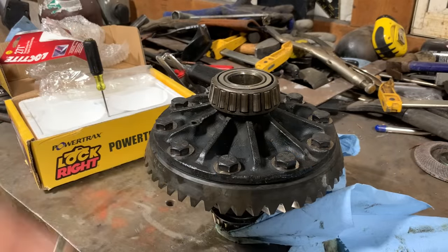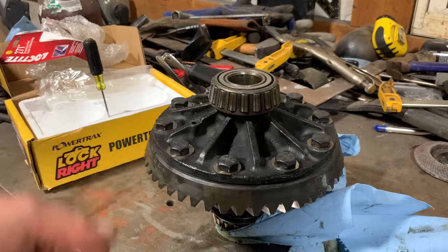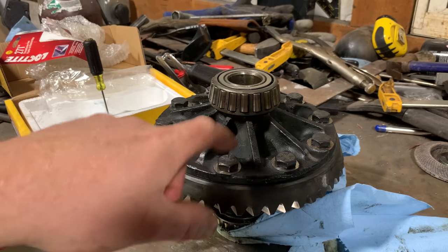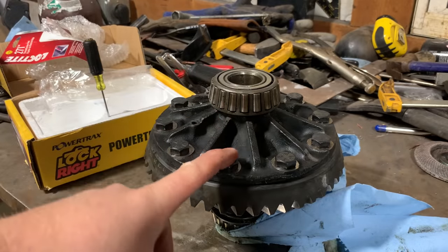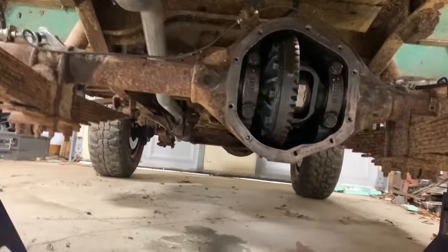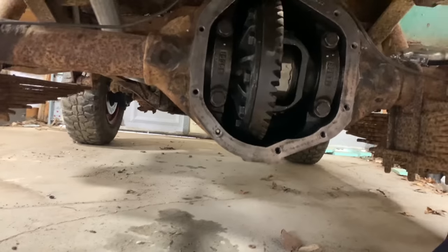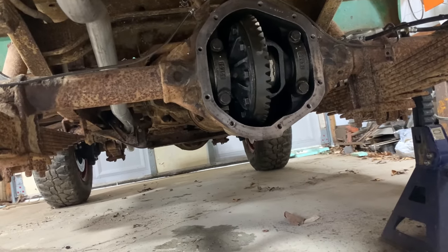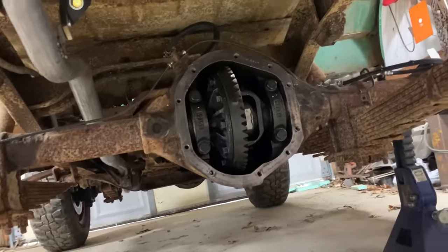I've got my ring gear back on. To recap: degrease everything, get as much oil off as you can, degrease the hardware. Red Loctite and locking tabs if you need them — you can buy reproduction ones too. I do Loctite and the locking tab because those tabs aren't that hard to bend. All these get torqued down in a star pattern, 38 to 42 foot-pounds. I went ahead and threw that carrier back in — it goes back in the same way it comes out, and it's tight both ways, so just take a dead blow and take your time. Torque the bearing cap bolts — originally the repair manual said 35 to 50, but later they changed it to 70 to 90 foot-pounds. I did them at 80.